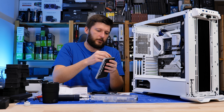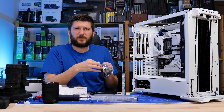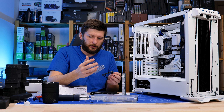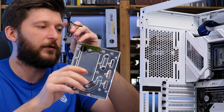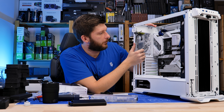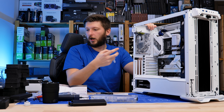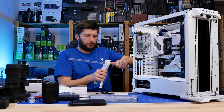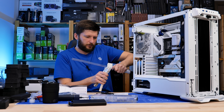More ARGB stuff — it should be just 120mm hole spacing, pretty easy. We have a closing piece for the drain/fill port, and as I mentioned in the first video, the ARGB cable is supposed to be mounted on this edge, which is kind of stupid. Let's put it in immediately — now we have this cable dangling there. I need to orient it correctly so that it still says Phanteks on the bottom and is straight. Before I completely block this off, I need to make sure the holes here and here align somewhat.